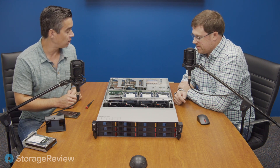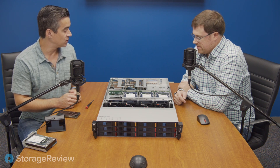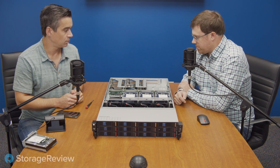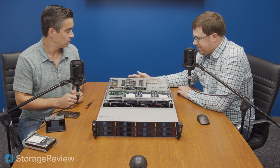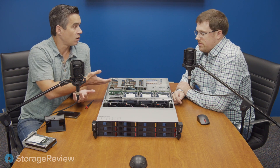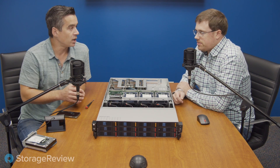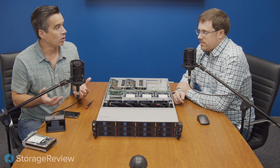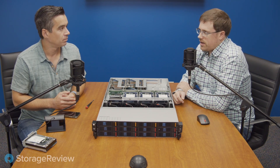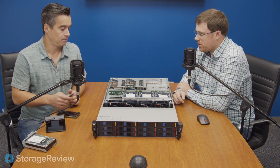As we slide to the back, there are two M.2 drives and a number of PCIe slots for expansion. You have six PCIe slots, which is pretty nice. And for high-speed Ethernet, you have four SFP Plus ports on the back. You always like the ports on board because then you don't have to use a card necessarily — you still have that IO flexibility. We're not seeing a lot of 10 gig on board, but it's increasing. You'll find certain 10 gig or 25 gig or RJ45 10 gig, but usually you don't find a lot of SFP Plus ports on board.